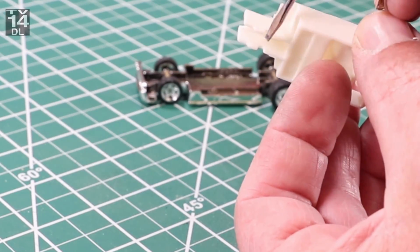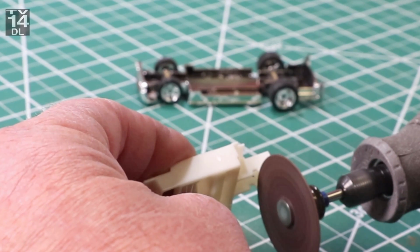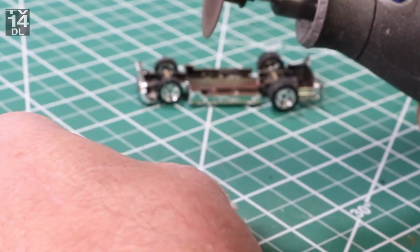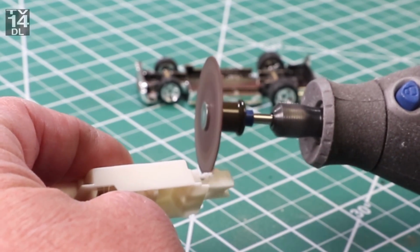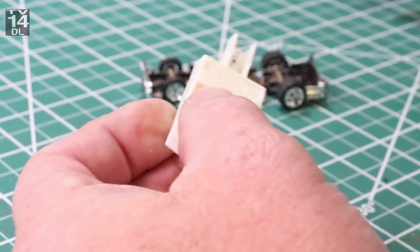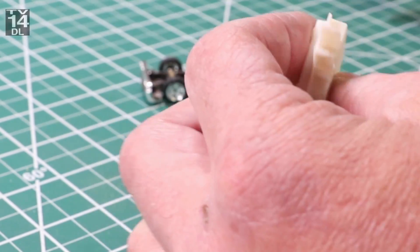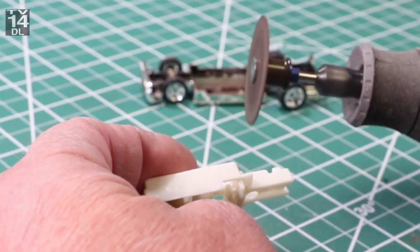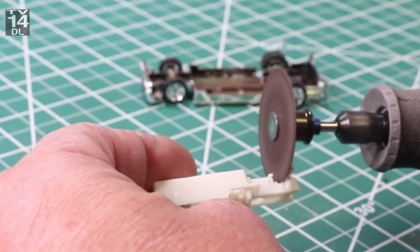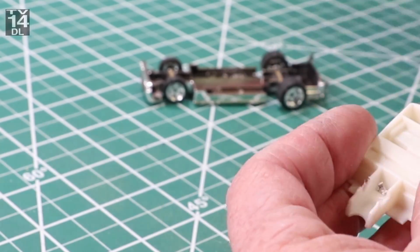It's a good roller. The other thing with axle tubes is if there's any kind of hold down, like on that interior, you have two C-notches that would hold the axle down, even though it's clipped in, and it kind of sits over where the axle goes. With an axle tube being a bigger diameter, obviously, if you're going to use the same interior, then you have to clean it out and enlarge it. That's what I'm doing there.